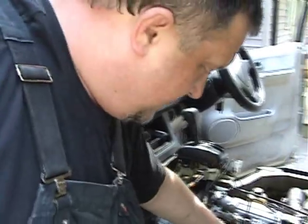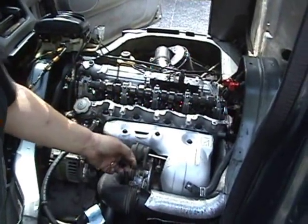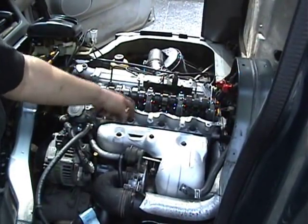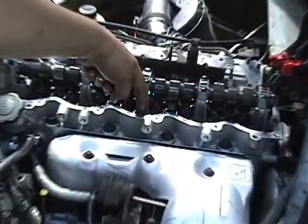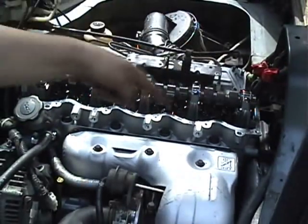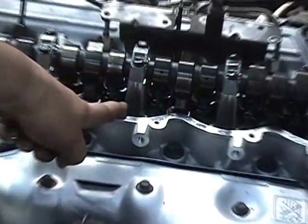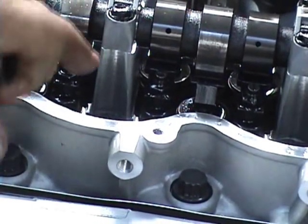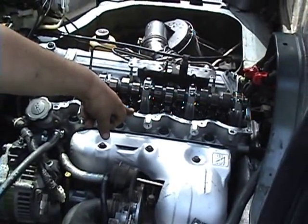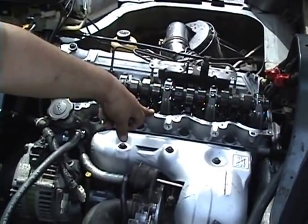And just while we're on the subject, the reassembly method is to, for example, when you orient your head bolt number 1, which is right here, you'd go 1, 2, 3, 4, 5, 6, 7 in a circular pattern. The torquing sequence is to bring all the head bolts down to 29 foot-pounds. As I say, I'm not sure what that is in Newton meters.